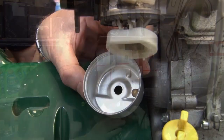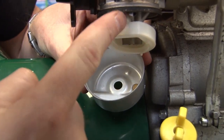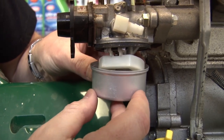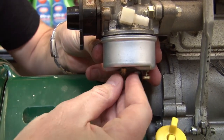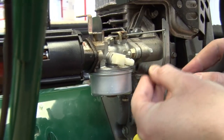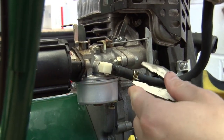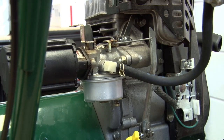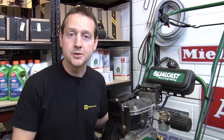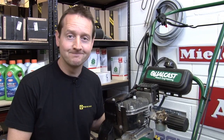Just check the gasket seal as well — this one's in perfectly good condition but if that's looking a bit of a mess then it's probably a good idea to replace that as well. Let's just put the carburetor back together. You can see on the float chamber there is a shallow end and a deep end — make sure you get the shallow end where the hinge of the float goes and then just put the screw back in. Don't forget to reconnect the fuel line and of course put the air filter back on. Top up with fresh fuel and we're ready to go. That should deal with most of the problems associated with getting your petrol lawn mower to start. Spare parts for Qualcast and lots of other makes of mower are available on the eSpares website. Thanks for watching.